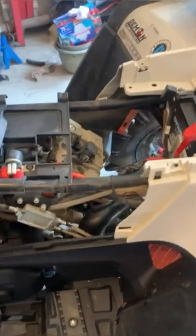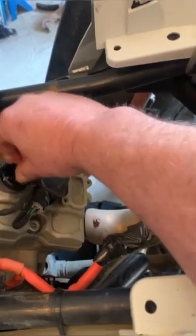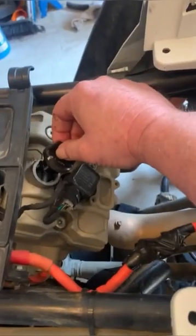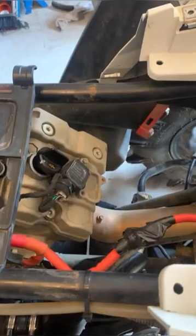Take your seat off the machine and it exposes the oil filler cap. Just turn that cap off so it gets air in the top — it helps more oil drain out the bottom when air can come in through the top. So we've got that done. The next thing we need to do is get the oil filter off.